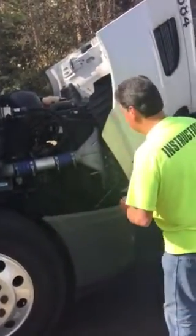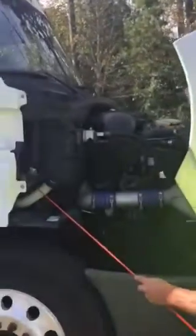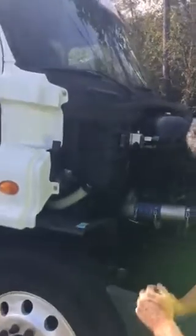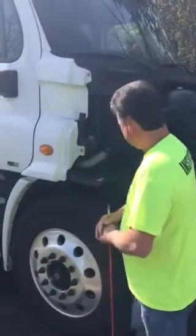Now I'm going to move to my belt. My belt is not cut, cracked, dry rot, or frayed, and it's at its proper tension — you shouldn't be able to move it more than half an inch. Then my windshield washer coolant reservoir: it's not bent, cracked, or broken, missing nuts, bolts, or screws, and it has a sight glass so I can see that it's filled to its proper level, and I see no leaks.